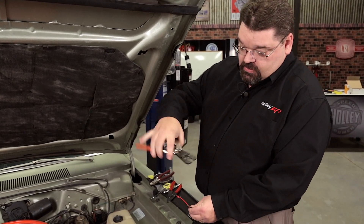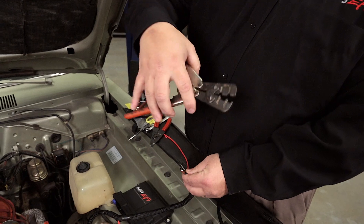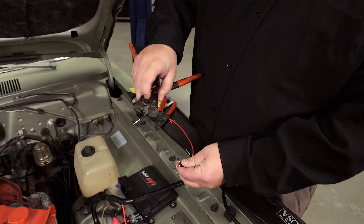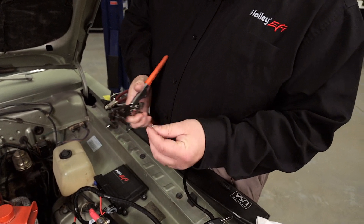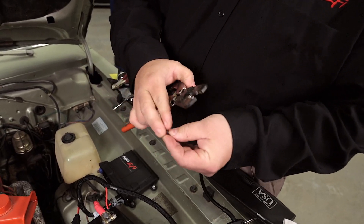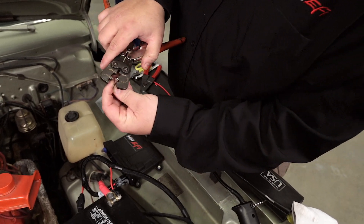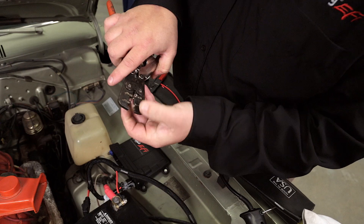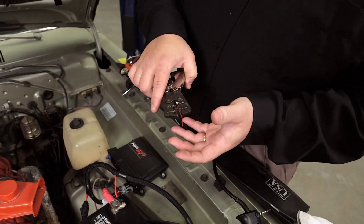This tool is designed for both insulated and non-insulated terminals, and it's important that you use the setting for bare, non-insulated terminals — the one with the bump. When you crimp a connection, look at the connector first and see where the split is. You always make sure that you saddle the split, meaning the bump end is on the back side, otherwise when you crimp it, it will separate the terminal and you won't get a proper crimp connection.